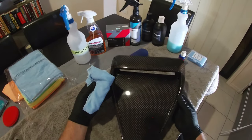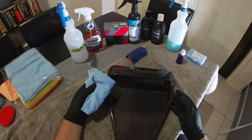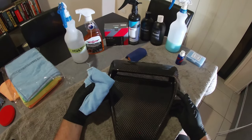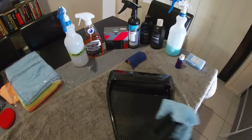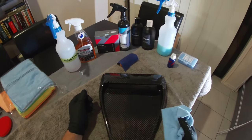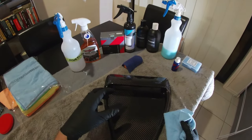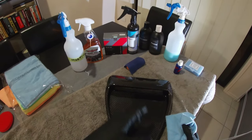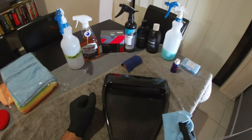What we need to do now is keep water away from this for 24 hours and keep chemicals away from it for about seven days. A car wash with pH neutral soap should be fine after a couple of days, but the first 24 hours definitely keep it dry. If it does get wet, you can use CarPro Reload — their sealant — on top of the coating after an hour of curing. But we're just going to leave this overnight and put it back on in the morning.